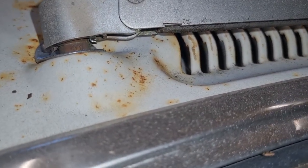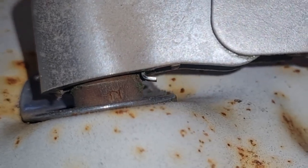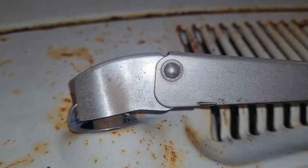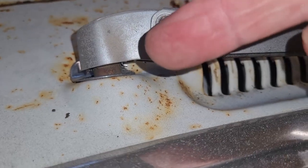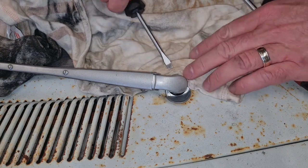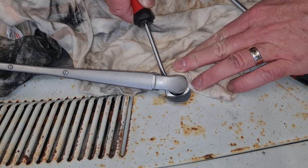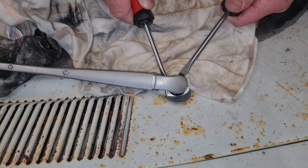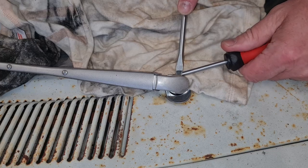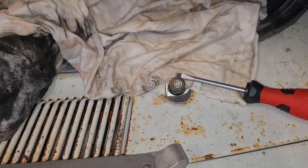First job, we've got to take off the wipers. Can you see that little silver clip just in front of my finger there? What you've got to do is hook that this way and then the wiper will just pop off. There's a little groove in there that it sits in so that the wiper doesn't come off. So first things first, put a cloth down to protect your paintwork and your trim. Use a screwdriver underneath to move that clip out of the way — and there she goes. One screwdriver against the other. There she is.